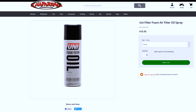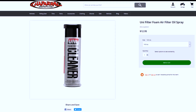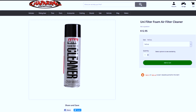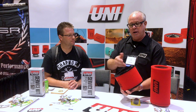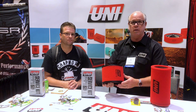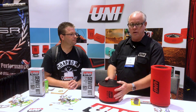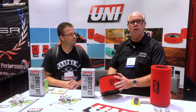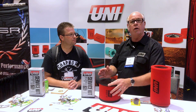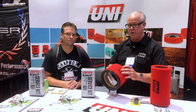The service is simply using the spray oil — spray it all over the filter inside and out. You want to completely saturate all the foam material. When it's dirty and you want to clean it, spray the cleaner on, let it soak, rinse it out, let it dry, then re-oil the element and you'll be ready to go again.